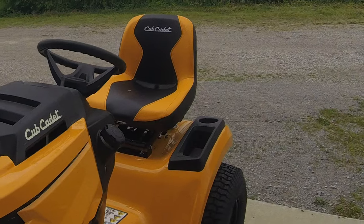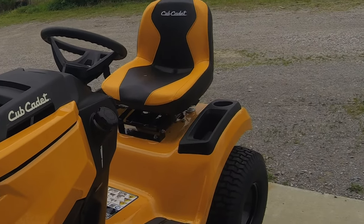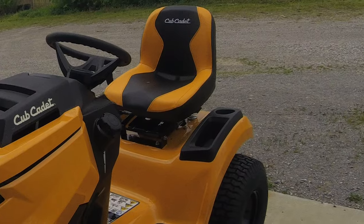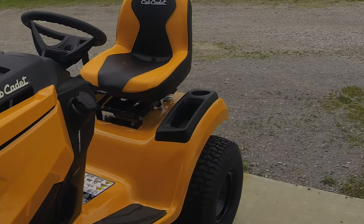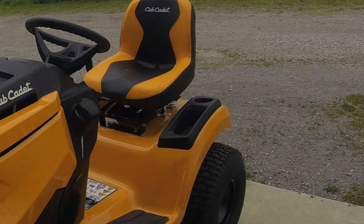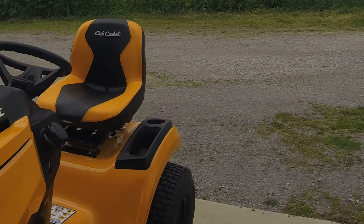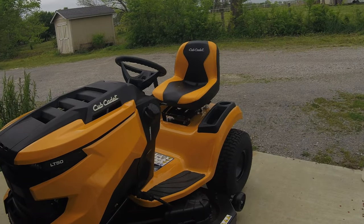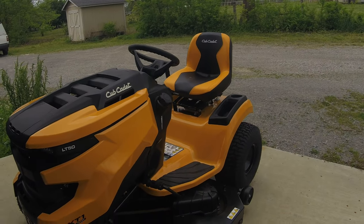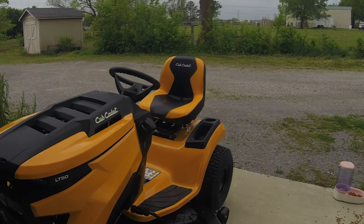Back when I first started buying mowers, I didn't learn about the stamped decks. By the way, it's a three blade, and if you get into the bigger decks with bigger yards, make sure it's a three blade. When you're swinging big old blades, I've seen some 48s with two blades, it just puts so much extra stress on the deck. It's not worth it. Buy an extra blade. Also, I find that the three blades seem to cut a little more even than the two blades. They're real easy to get one of them off to where it scalps on one side.